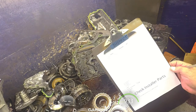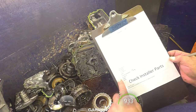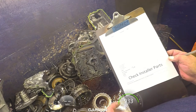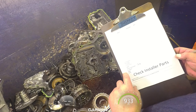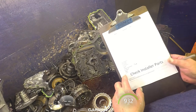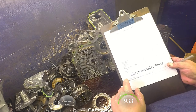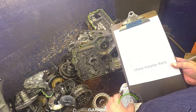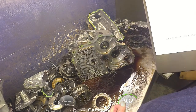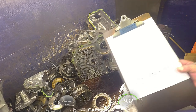All right, doing an LS kit with pistons, filter, updated tubes, and a torque converter. On your converter, on the hub side that goes into the tranny, there'll either be an ink stamp, which mine had this time, it's PP, or sometimes it's stamped in with a metal stamp. So just look for that, and that helps identify which torque converter you need.